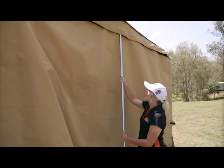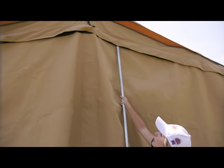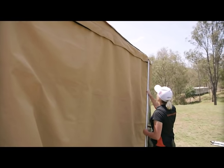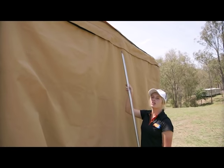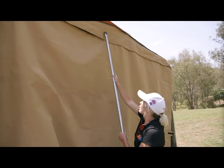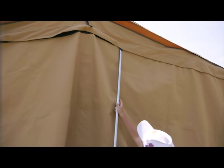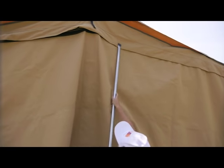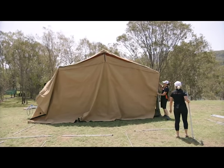Follow it all the way to the end of that piece at the front of the camper. It's very important that you get all the kinks out of your velcro so that when you do get rain, it's going to be covering all your zippers so you have no leaks. Just come along with the flat end so you're not going to damage the canvas — just come along and pat it as you go, and when you get to the peak just keep patting it.